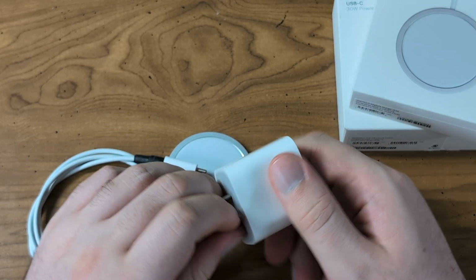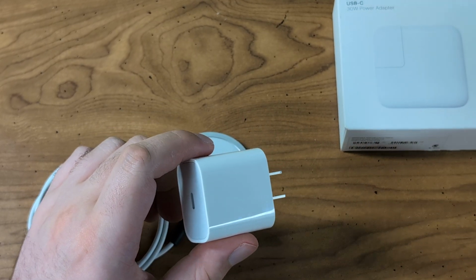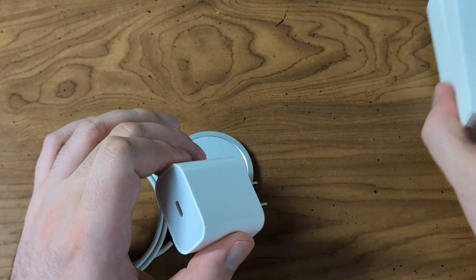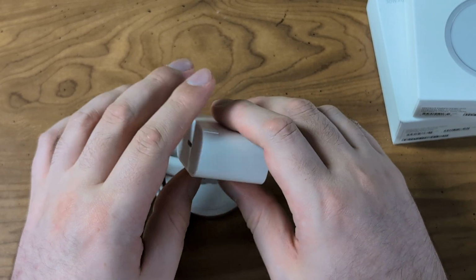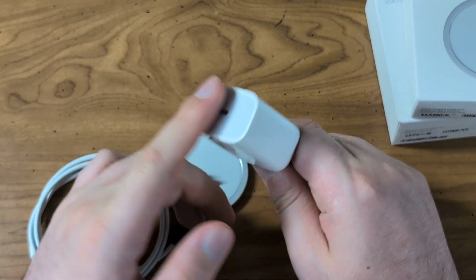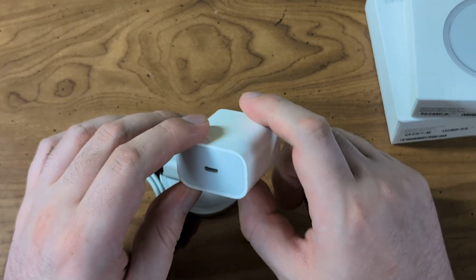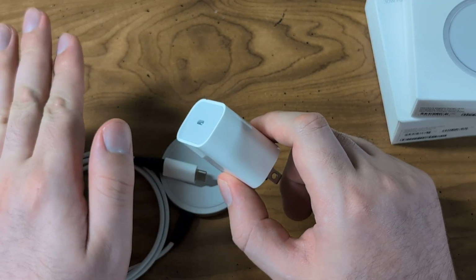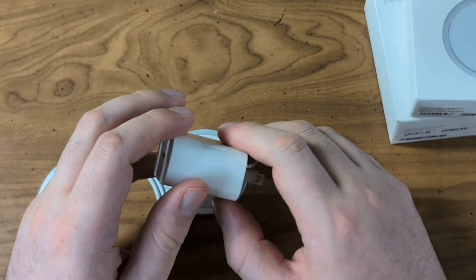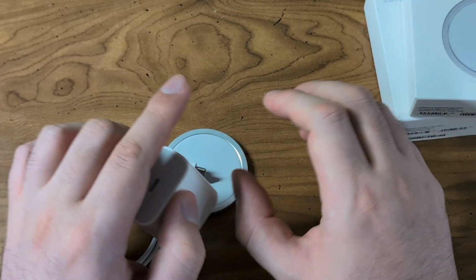But I was complaining about my Anker PowerPort Atom, which is a 30 watt. I think it's actually made to replace this guy, or the predecessor of this guy potentially. What we found out, because I was wondering why the fuck is it not quick charging my Pixel? Well, in order to quick charge the Pixel 9 Pro, you need 27 watts. It's a 30 watt charger, so you're like, oh, it's good. No, specifically the Pixel 9 Pro does 27 watts because all Pixels previously have been 18 watt fast charge, because they were 9 volt 2 amp. Maybe not all previous. I think the Pixel 9 is slightly slower, still on 9 volt though.